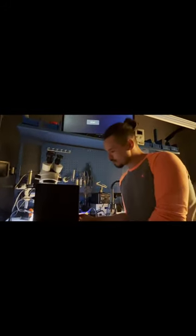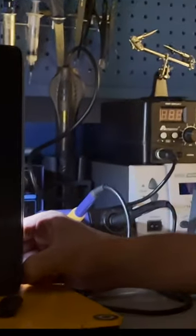So now that we got this system all hooked up, what we're gonna go ahead and do is hold this power switch until we hear it beep twice. Upon the second beep, we'll know that it will boot into safe mode. There's our second one, so we'll go ahead and let go. From here, we'll give it a second to start up and it should boot into safe mode. Once it's in safe mode, we'll just have to pair our testing controller to the system.